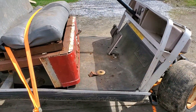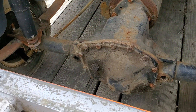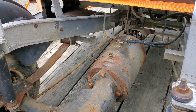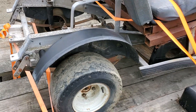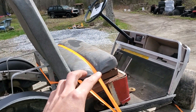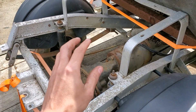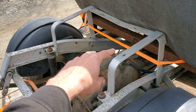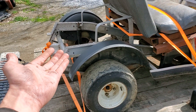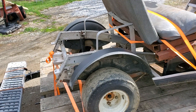This one has all the pedal assembly, brakes, and everything in place. It's an older motor setup with a variable resistor that we'll probably swap out with a speed controller and see if we can get it running that way. I'm thinking we put some low-wattage batteries in, give it a 24-volt controller, and just punch the motor a little bit and see if things will move. We'll lift the rear end and pull the brakes so there's no resistance that doesn't need to be there.